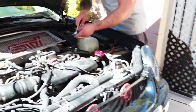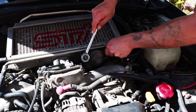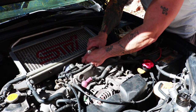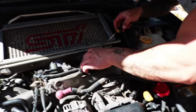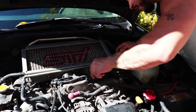Alright, the first thing we're gonna do is take off the two 12 millimeter bolts that hold the recirculating valve to the intercooler. Make sure to hold on to the gasket so you don't lose that down under the intake, because that might be a pain to get out — you might have to take the whole intercooler off to get to it. Then you're gonna disconnect the hose that's connected to the bottom of the valve, and then it should just pop off.